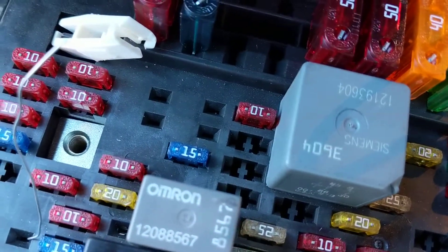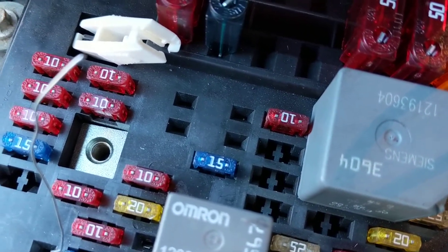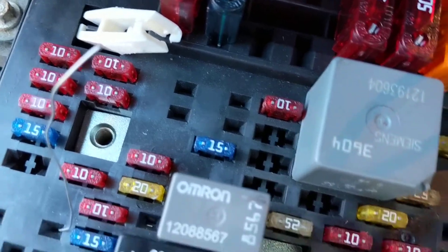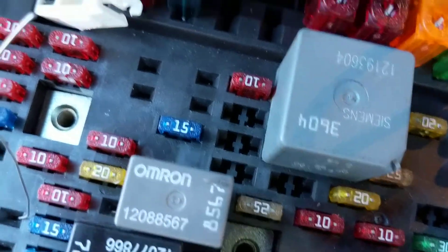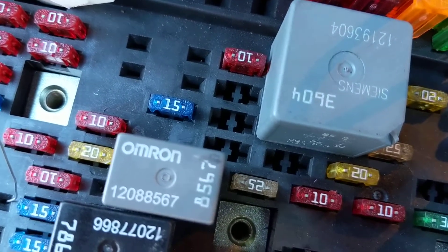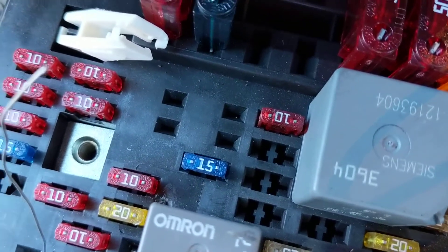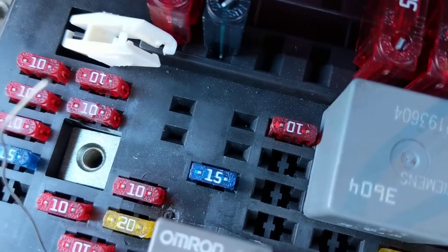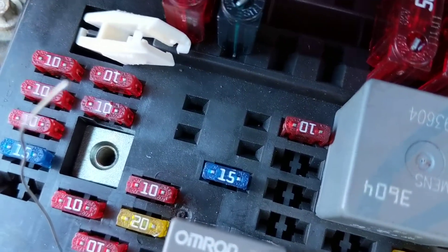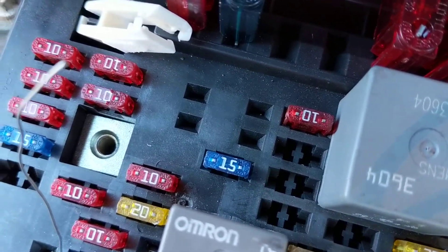Anyway, this is the true way — any relay: fuel pump relay, headlamp, starter motor, anything. This is the proper way to measure relays. Do not take a relay out by jumping it; you don't need a power probe. I hope this was clear. And again, the other video about the mass airflow sensor with the scope — the gist of it was you have to look at the signal; do not look at DC volts with the multimeter. All you're going to measure is the reference — it's useless. Always put a signal on it. Now we'll go on to the next one.